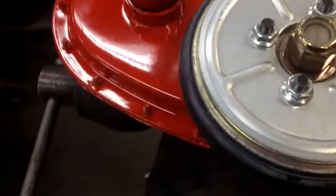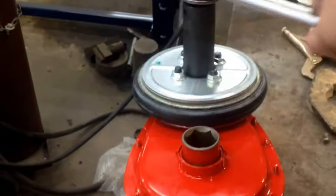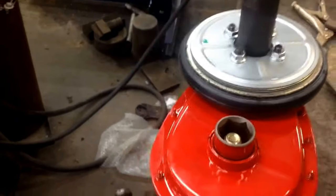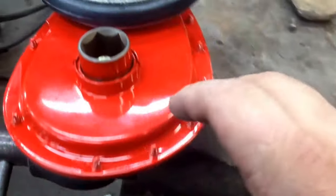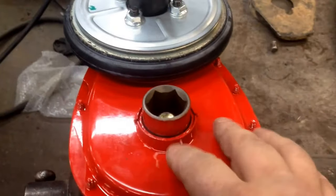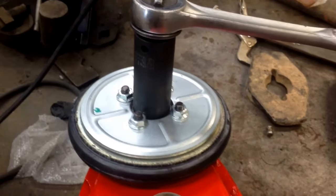As you can tell, when you go to try to tighten this up, see how it's going to spin around on itself. So basically you're going to have to hold this transmission by hand, and there'll be enough gear reduction inside of this transmission to where you can run this nut down with no problem.